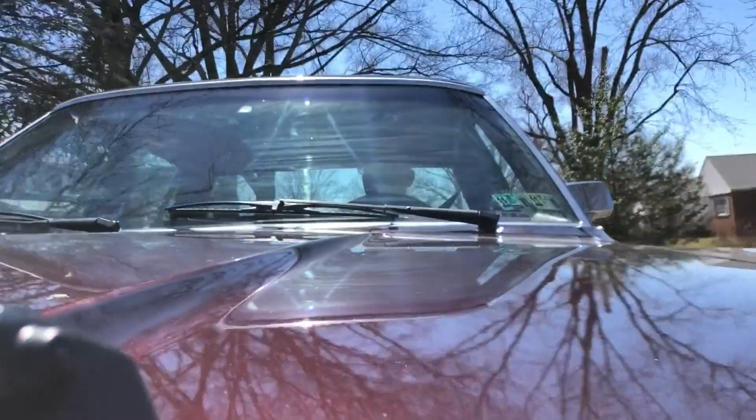And nobody knew where the peak was going to be, and nobody knew how high it was going to go. And so Chrysler and the engineers decided to eke out every last mile per gallon out of this engine using the most highway-friendly gear ratio possible. Now, performance cars in the 60s had a gear ratio of 3.73 or 4.10. A nice family commuter might have a 3.23 gear ratio, or maybe even a really highway-friendly 3-to-1. This car, 2.2-to-1 gear ratio. Outrageous.